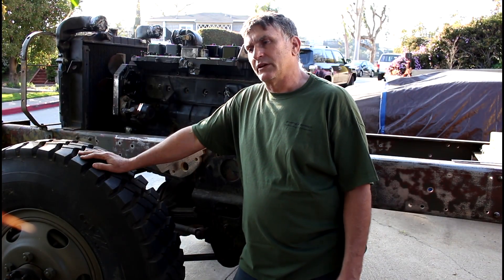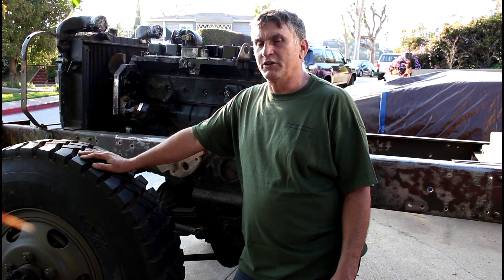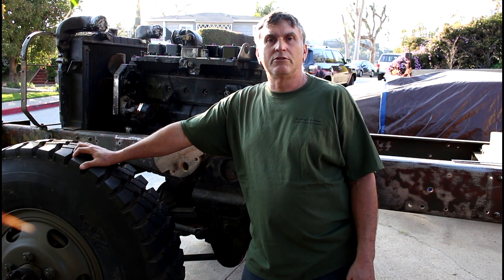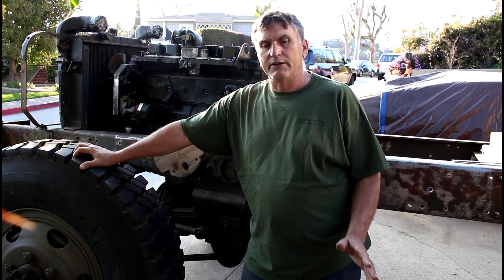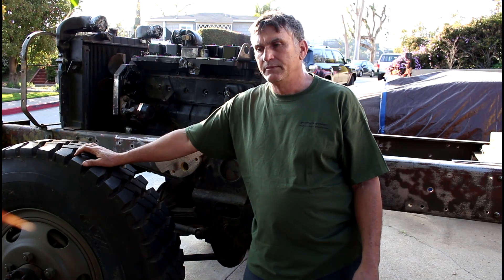Welcome to Gentry's Garage. I thought I'd give you an insight into my thought process when I'm fabricating something totally different than what the manufacturer built. In this case we're putting the Ross HF54 power steering on it because I'd like for my wife to be able to drive my truck. We're also doing the HydroMax brake system, which is going to take much more room from the frame than the original master cylinder did. I thought I'd just break you in on the process.